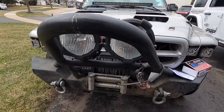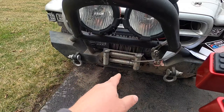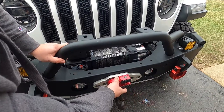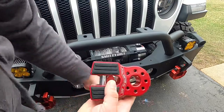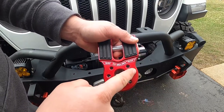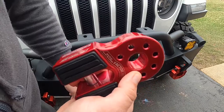This works on steel cables with a roller fairlead as well as synthetic rope with an aluminum fairlead. It will neatly fold and stay in place. It replaces the open-end hook and gives you a safer option — you run a closed screw-type D-shackle on here, so there are no openings. It is a closed system.